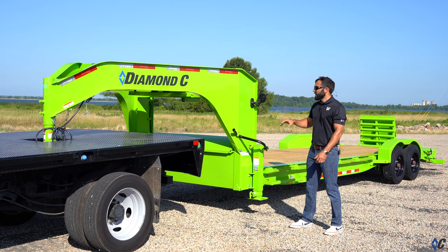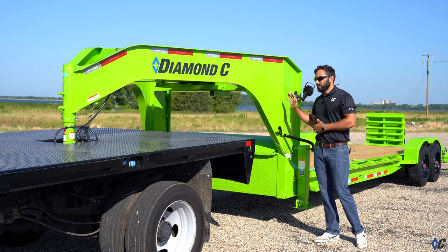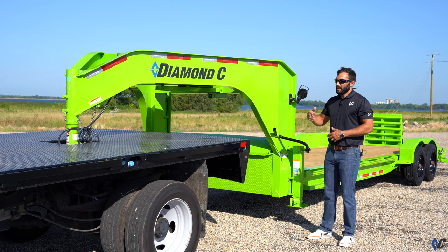At the front, he chose the engineered gooseneck package. The gooseneck package is great because when you're hauling concentrated equipment, it distributes the weight of the load further up the frame of the truck for better towing. Some say it backs better too. And as we all know, if you have a trailer, you suddenly have many new best friends that want to borrow it — and a gooseneck kind of deters that a little bit.